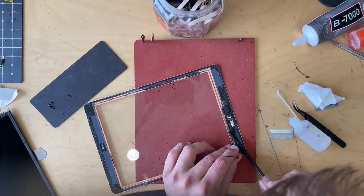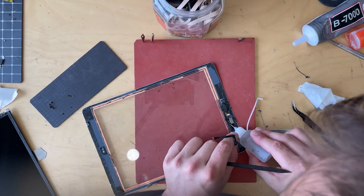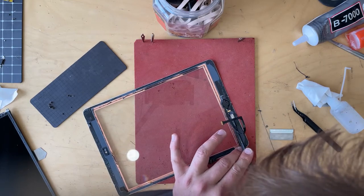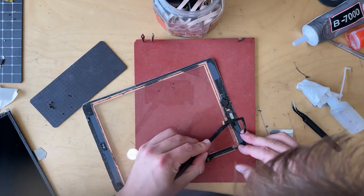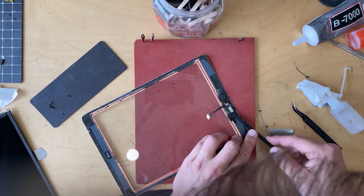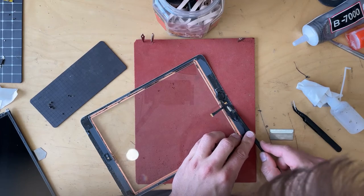This was pretty stuck down — I'm not going to force it. Just a little bit more ISO under there. I'm coming at it from this angle because if I come from the other angle and I'm not quite right I could damage it; from this angle it's foolproof — I can slip and slide without issue. Just a little bit of wobble, not prying, just working my way under there. And once you get to this point, we're free.